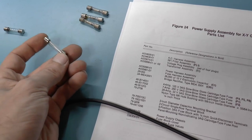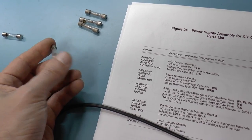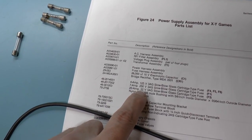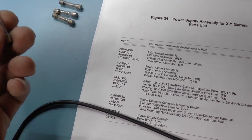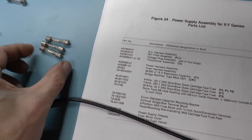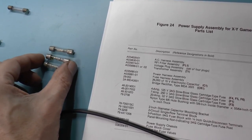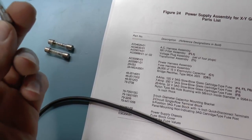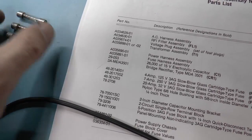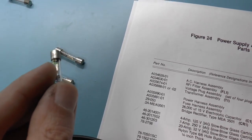This one that was in the spare — I thought was small, but that was actually just the reflection. There's a pretty thick wire in here. This is actually correct — it's 32 volts at 20 amps, so this is the correct fuse. And these are also the correct fuses — these are all 4 amps at 125 volts. This one looks a little bit odd, because there's some yellowing in there. It's very hard to see on the camera.